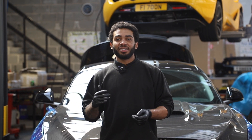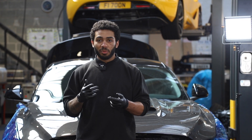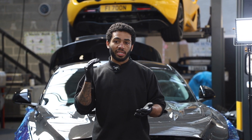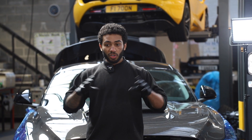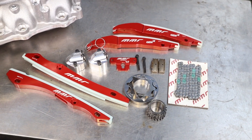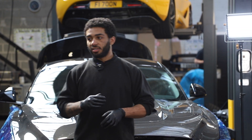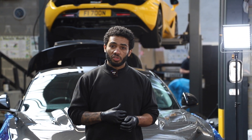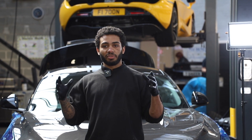Welcome back to Back TV. Today is Part 2 of Tom Green's supercharger build. We're going to be taking apart the engine, fitting the MMR oil pump and crank gear, and the full front cover assembly upgrade from MMR. He's getting the billet chain guides, billet tensioners, secondary chain tensioner upgrade — he's getting the works. We'll get this engine stripped, get those parts installed, and once that's all back together we can start fitting the supercharger.